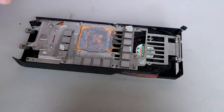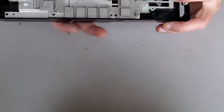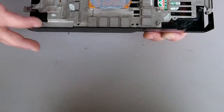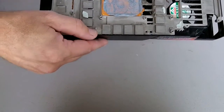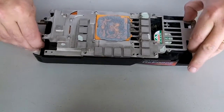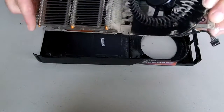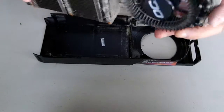We take out the circuit board. On the BFG model, to take out the heat sink you have four screws to remove. On most other cards the cover will just snap out of the bracket. We take out the heat sink — you can see it's pretty dirty — so we'll go ahead and blow that out.